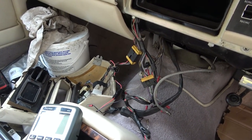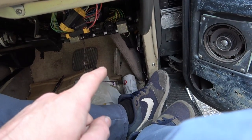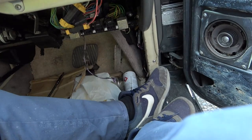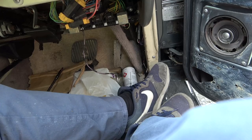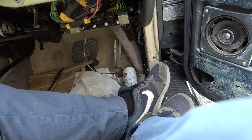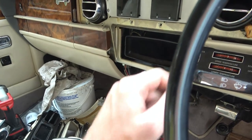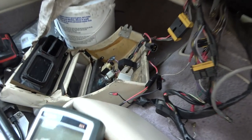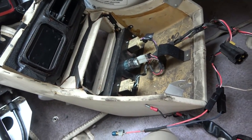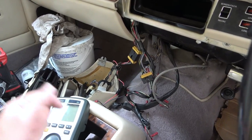And the thing is, the more things we uncover, so for example, I now know that there's a load of rusty connectors in here. Since I've messed with that, my central locking seems to be working better. It's not locking everything, but it's now opening everything, I think, from the driver's door. Still needs work. But you see, when I find where this goes to, I might find another load of rusty connections, which then might fix the heater or something else. So in my opinion, I don't think it's a waste of time. I mean, I hope you guys are still enjoying it, because for me, these are like blue map fix it videos. You know, why is that light not working?